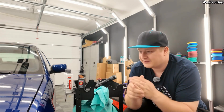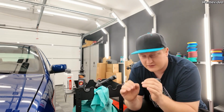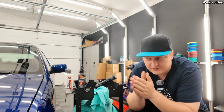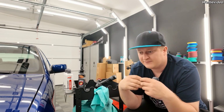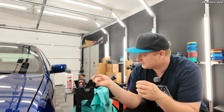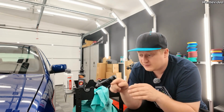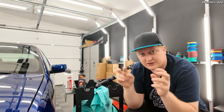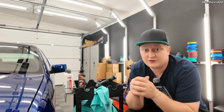Additionally, there is an exciting video demonstrating how to place the microfiber pad evenly, choosing a very low speed, gradually adjusting, and maintaining a consistent speed with the movement of the machine. Not too fast, not too slow. Control the heat so that it doesn't rise too much, because if you let it spin too quickly, you will have an incredibly high cutting performance, especially with a microfiber pad and a cutting compound. It really takes off. And you definitely don't want to polish a hood like that, where the edges are a bit curved downwards, and suddenly you polish through the paint at the edge, revealing a light blue or maybe even white, or you can see the metal underneath. That can happen quite quickly.